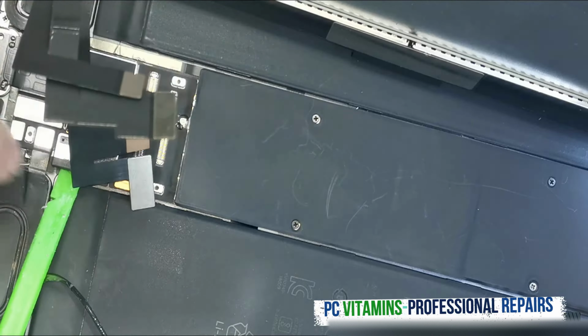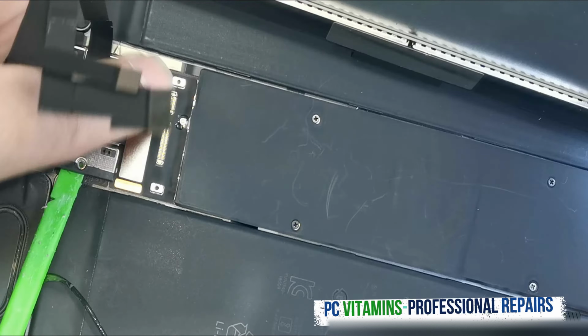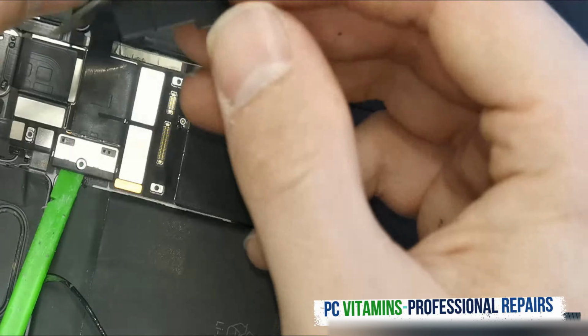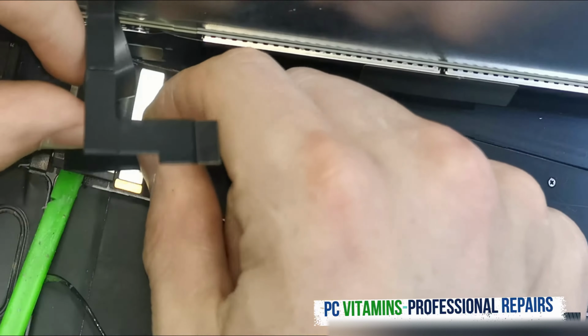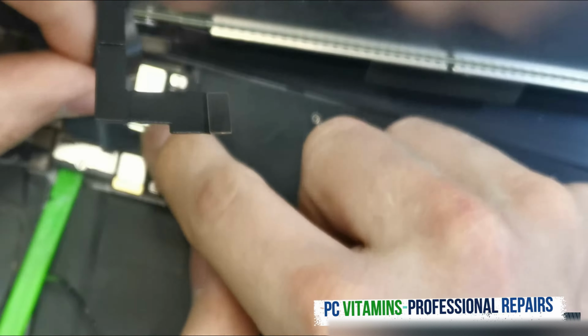Do not connect this display without disconnecting the battery. It will cause a short on the backlight circuit, and good luck trying to fix it because there are no schematics for it. There is pretty much no help. You're on your own if you get no backlight or you see smoke come out of the iPad.